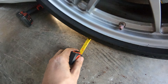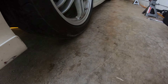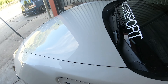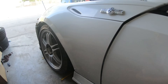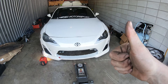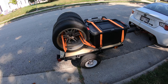I've got just a very small amount of toe in, which is all right. I'll take it for a drive and see how it feels, but I have to wait for Chris to get my tires done first. I figured I'd align it while I wait for the receiver to be delivered - just one less thing to do. Then I'll jack up the car, adjust the tie rods, put the car back down, make sure the wheel's centered and measure it again. Once I get it pretty good, I'll call it done.